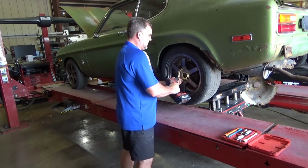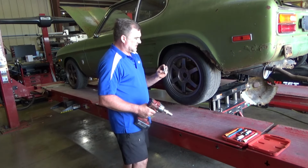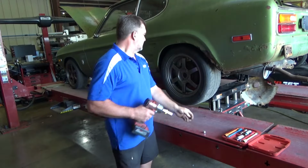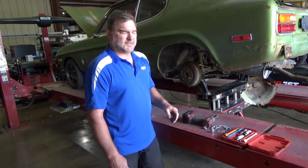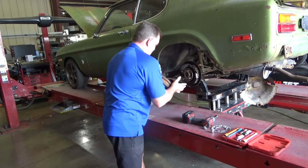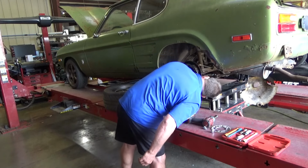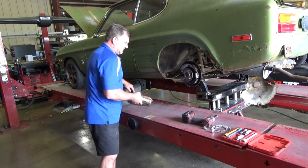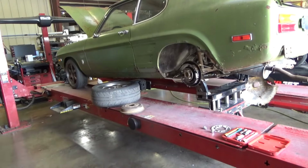Weekend. Have a couple of quick wins. So I was getting maybe half of that lug nut contact, which is less than desirable. I just frequently fix stuff. Sometimes I get it right. Oh, that's not cool. Something's wet in there. Wheel cylinder's new. Shouldn't be the wheel cylinder. Hopefully it's not the axle seal.